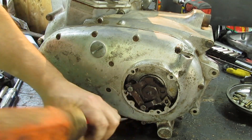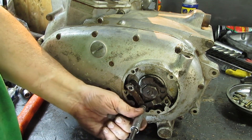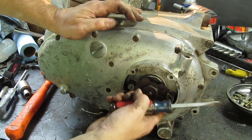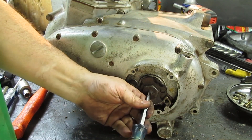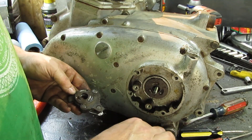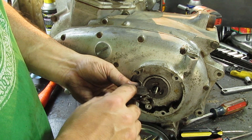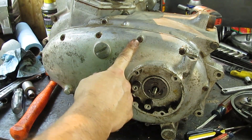I'm starting to think this bike had a catastrophic failure — something more major than dropping a second gear. This is your clutch engager: the cable comes through here, goes on there — this is where you adjust the clutch. These little ramps and a ball bearing in each ramp — as you pull it, it pulls the clutch. Okay, now we can get the outer case off.